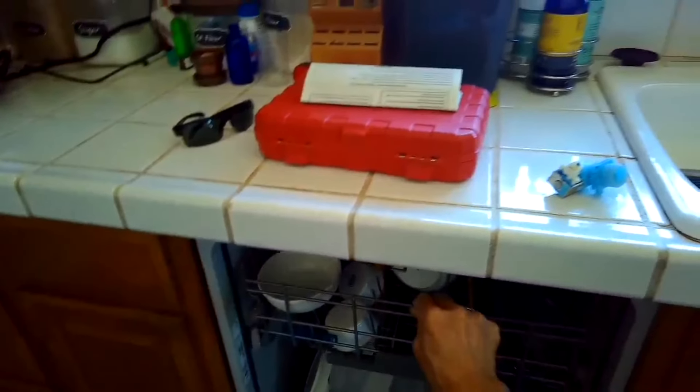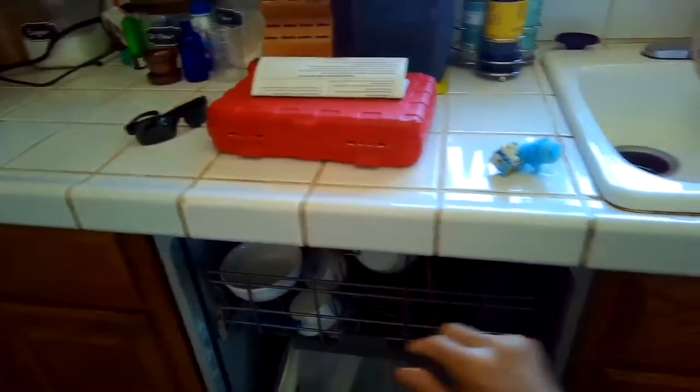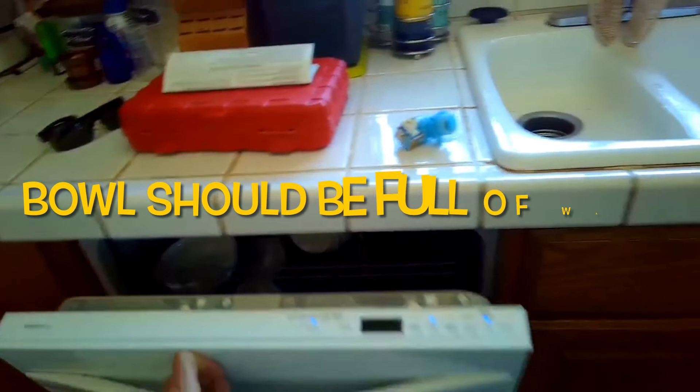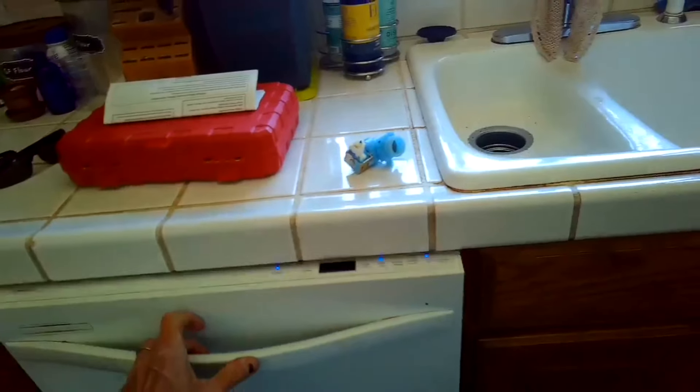If the bowl does fill up with water, you know that you're getting the right amount of water in your dishwasher and you know that the pump is working well. It's circulating all the water and the spray arms are clear, so all the water is getting up to the upper rack.